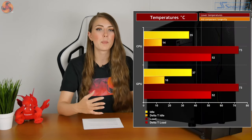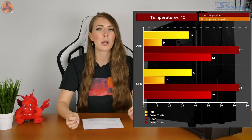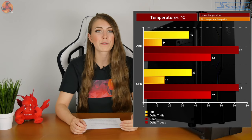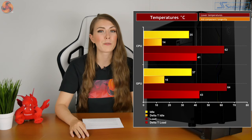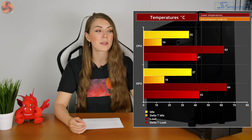The downside of it being a more closed-off case is that it also doesn't have very good airflow. When it came to temperature testing it did seem to be quite a warm case. Idle temperatures were fine, but as soon as I put the components under load it started working like a hot box — temperatures creeping up and up. I also tested the same load with the front panel removed, letting the fans have all the airflow they needed, and I saw a drop of 10 degrees in temperature from both the CPU and GPU. That is obviously a significant difference, showing that airflow is seriously restricted by that front panel.